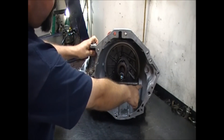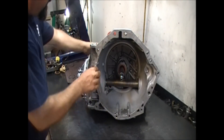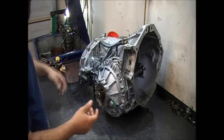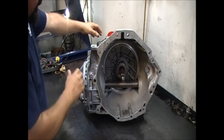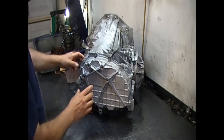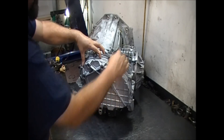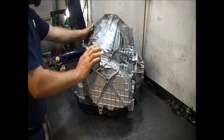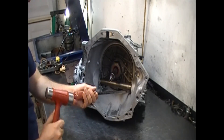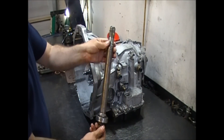This axle goes from one side of the transmission to the front of the pump and to the differential. This is a front-wheel drive unit but it's an inline motor, like it would be rear-wheel drive, so you have the differential here, the final drive gear, and everything in the barrel of the case. In the back you have a chain that moves the final drive to move the differential. Now that I've got that removed, it pops right out.